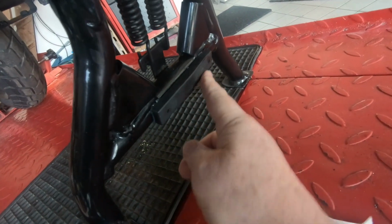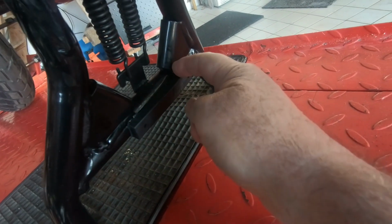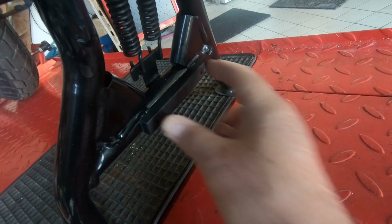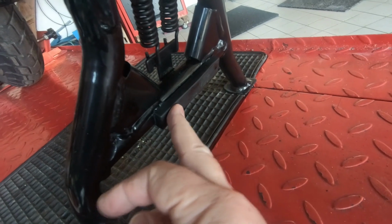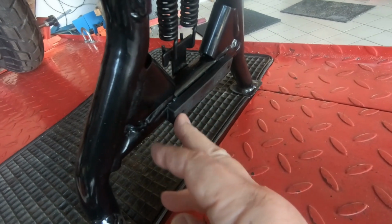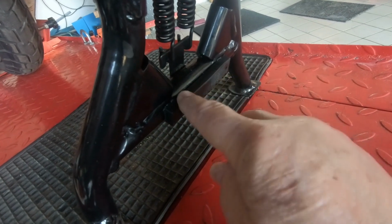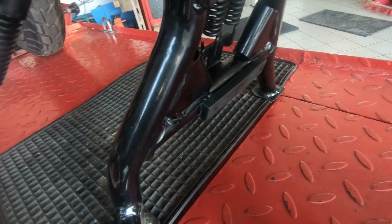I'm going to take now, as you can see, there's a rubber here. See this? Yeah? Now that rubber, literally, there's two holes, one about there and one about there, drilled in. And there's two little plippy things on the other side of this rubber, and it just pops in. But I tell you something, it was extremely loose, and it wouldn't be long before you lost this. And if you lose that and you put this up, then it comes whacking up here into the collector box. So what I did, I took it out, and I just put on each of the holes a bit of silicone on the back of here, stuck it on. That's as solid as a rock now. So there's one, and that saves that flicking off.